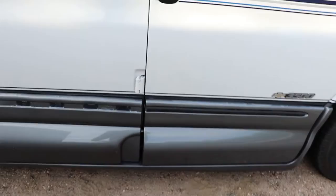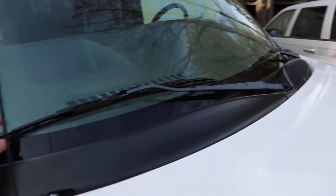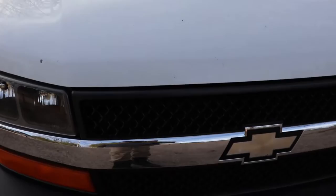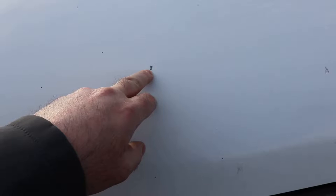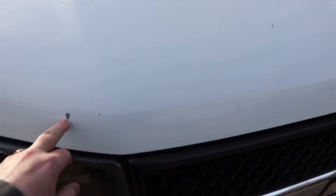The paint is starting to peel. Look for anything on the roof and make sure your wipers aren't stuck to the glass because you're going to turn them on shortly. Check your hood — these vans are notorious for chipped paint on the hood. Never pressure wash these vans because once water gets under the paint it'll blow it all off. The paint might fall off on its own anyway, but you don't need to help it.